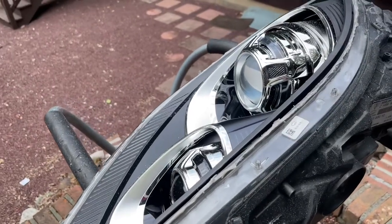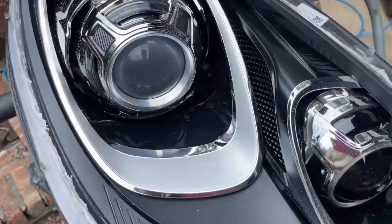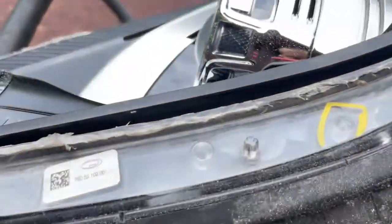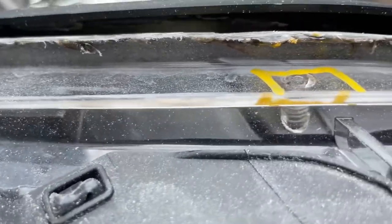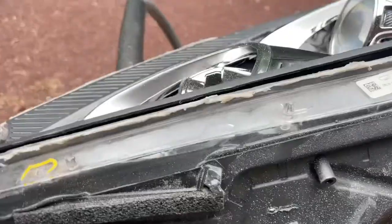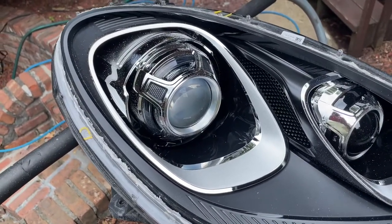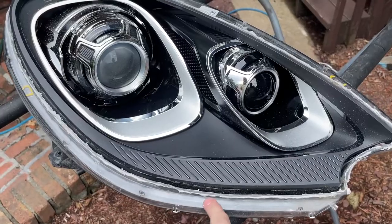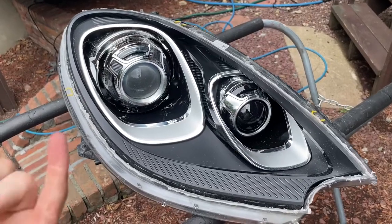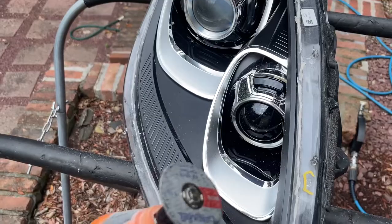I'm actually going to be painting all of the chrome pieces, so I'll walk through that as well. You have to start with all of the little screws going around the periphery. I drew a little box around each one of these screws — you can see them through the lens where they come out. What I'm going to do is cut out that area so that I'm able to remove the main accessories of the housing, and then that'll enable us to heat up the housing and get rid of the remainder of the headlight lens that is adhered and sealed to the housing. For this I'm just using a Dremel with a simple cutoff wheel.